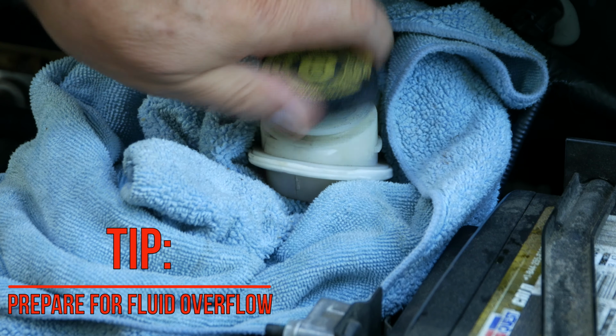The car's wheel is replaced and the lug nuts hand-tightened for the moment. Snug up the lug nuts while the wheel is still in the air. The safety stand is removed, and the jack is lowered until the tire touches the ground.